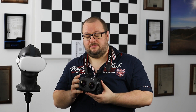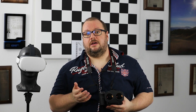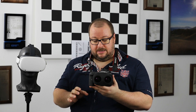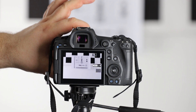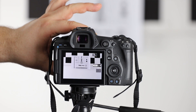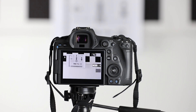This lens needs manual focusing — there is no autofocus — which you can change on the ring. If you look online for camera test patterns, you can print them out at your highest DPI resolution, set up your camera on a tripod, and calibrate using the display. With the magnifying lens button you can zoom in to check focus sharpness. Because you have a left eye and a right eye view, you can use the info button to switch between them. Focus the left lens first, confirm it's sharp — you may see a moiré pattern where it's sharpest — then switch to the right lens. If there's misalignment between left and right, there's a screw on the lens you can manually adjust with a tool to realign.